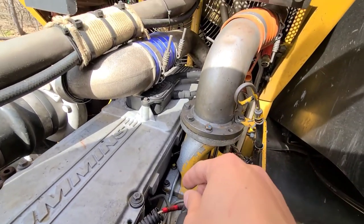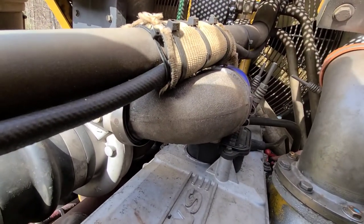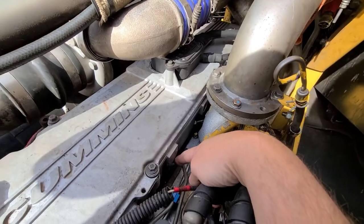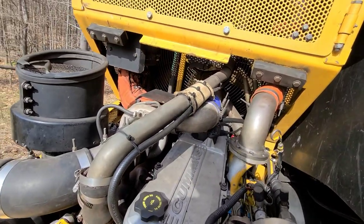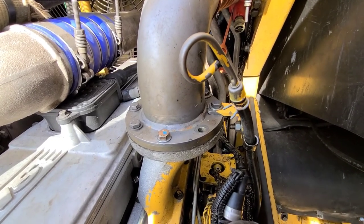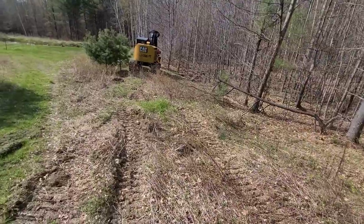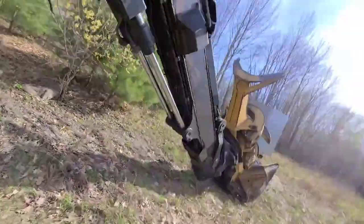It had always been kind of wet in here around these injectors when I bought it. They found that one of these little fittings was cross-threaded and one of the O-rings was bad, so it was leaking fuel — they fixed that. They also fixed a wire for the accumulators. The accumulator arm had issues usually when you first started it, but once it warmed up it seemed to come out of it — turned out it was just a broken wire.